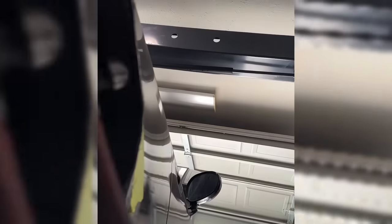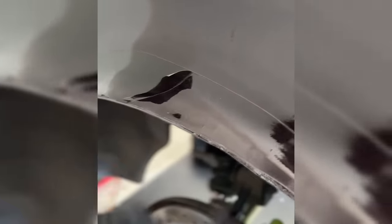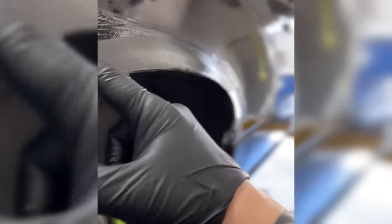We've got a cool flare as you can see, but it's very wavy. So I took a ball-peen hammer and started very lightly tapping it and sort of shaping it the best I could. This is also where I decided it was time to get the wrap off — the wrap's just old, it's bad, and it was already coming off anyway. The body is wavy, and the way to go against that is use either Bondo or this material called panel bond. Love using this stuff as a base — super nice.